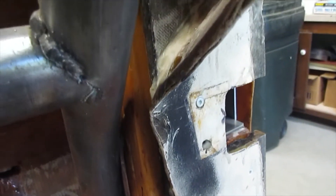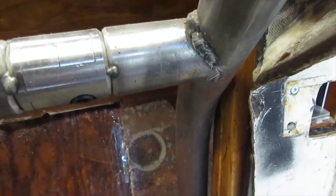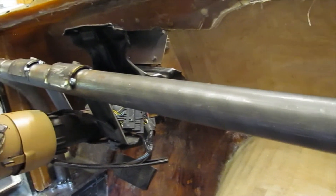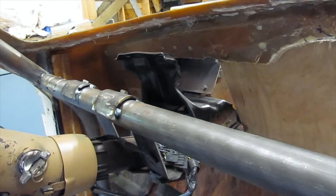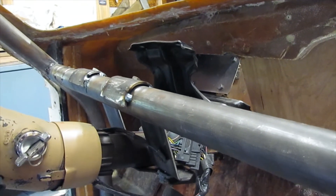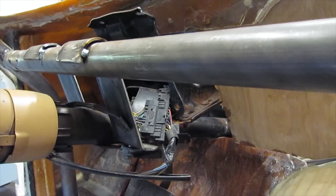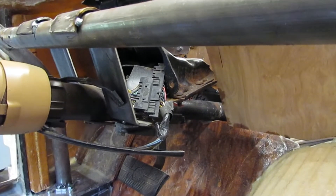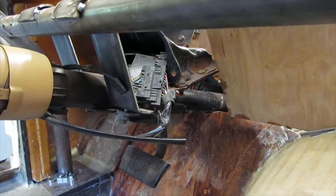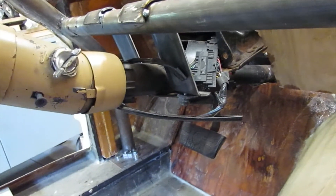I've also made use of the roll cage here to make the dash bar — again a removable dash bar, same thing with that interlocking tube coupling. Over to the other side, I've got the steering column mounts from the Corvette steering column mounted on brackets that I made up underneath there, just welded in now. These brackets include all of the master cylinder and brake pedal mounts from the Corvette, so the driving geometry is the same.